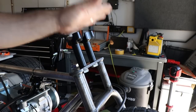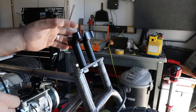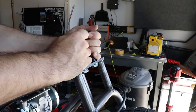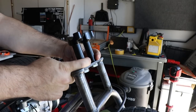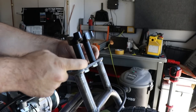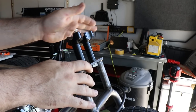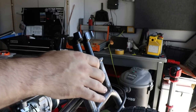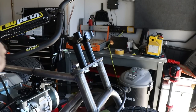I ordered a top clamp. Now, the top clamp for this style has the offset spacing, wider at the top, narrow at the bottom. It's more for Harleys and things like that. But the problem is that the spacing between where the riser posts come up is further apart. So I'm still going to order the top clamp that goes with these, and I'm not going to drill the triple tree area,